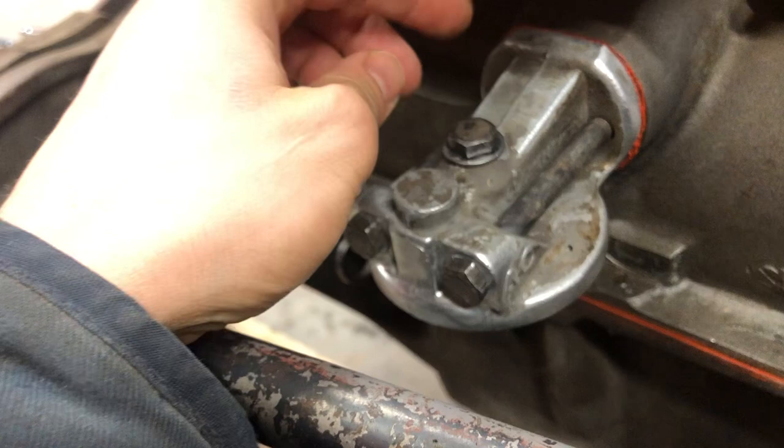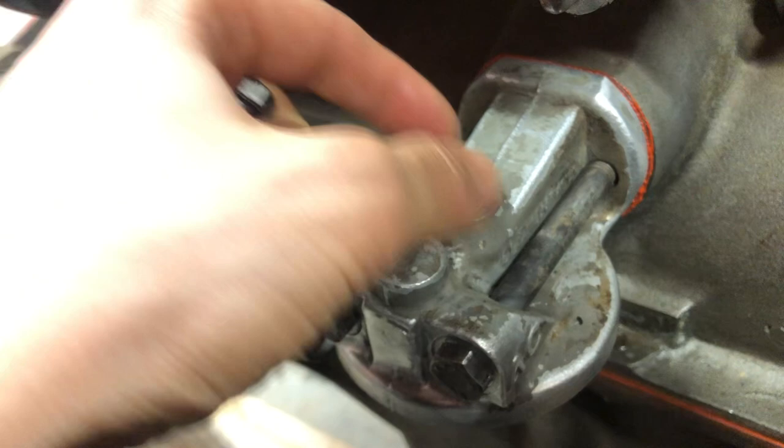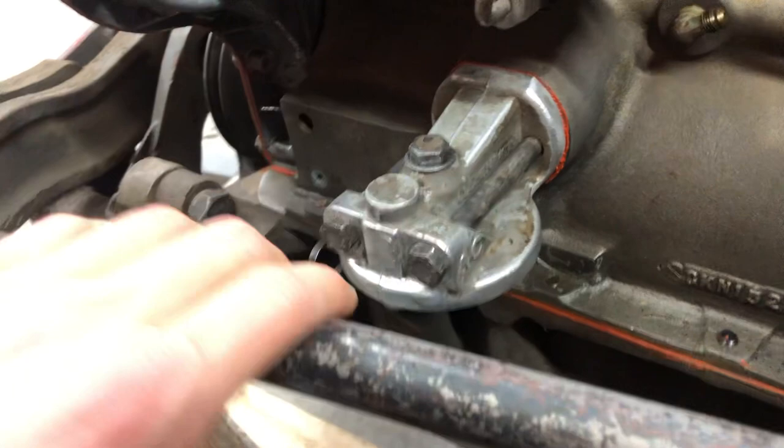There's a bolt on the top right there — this bolt is what pulls the oil filter housing up and seals it off. We'll see how we're doing with leakage. I've cleaned this up and ran the wire wheel over it, so it should be a hundred percent. But if it's leaking here, I'll replace this washer, probably with a copper washer. We'll see — for now this is going to stay.